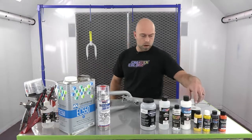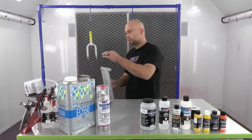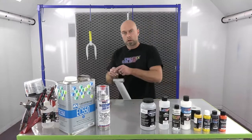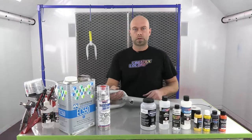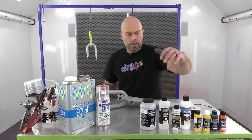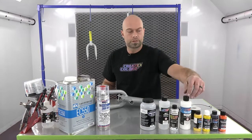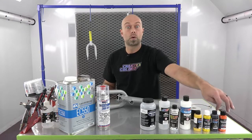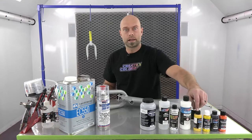A little bit of mechanics wire twisted up - I made a little mount for the fork and I have it going through the front of the head tube so I can hang this right next to it. I'm going to do silver sealer on both parts, let that dry, and then put on two coats of Hot Rod Sparkle White because I really want this thing to be glittery. On the table I have Hot Rod Sparkle White, my 40-50 for the color phase, two pearls - Wicked Pearl Yellow and Wicked Pearl Orange - and corresponding candies: Grabber Orange and Lemon Yellow.